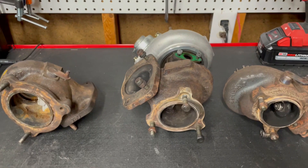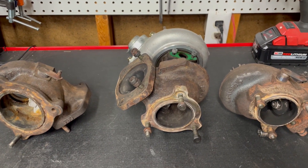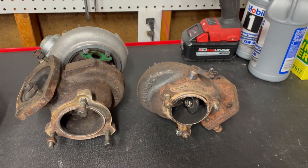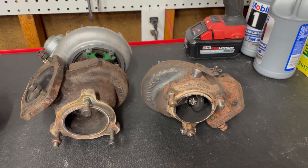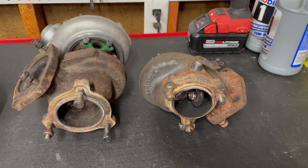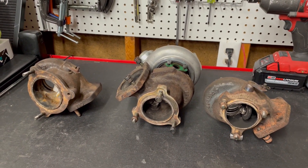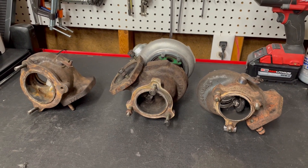My personal favorite is probably the straight flange. I think it's a good Goldilocks option — you don't have to worry about the crazy custom fabrication of the angled flange, but you can still make it work if you've got that section of downpipe. The conical flange is doable — my understanding is that it's still going to be a good bit more flow than your 13C turbo, but you'll be somewhat limited in flow because of that smaller outlet. It just depends on what you're after. Everything's a compromise — weigh your pros and cons. I do know someone who has made the angled flange work; it is possible, but ultimately that's up to you and how much work you want to do.